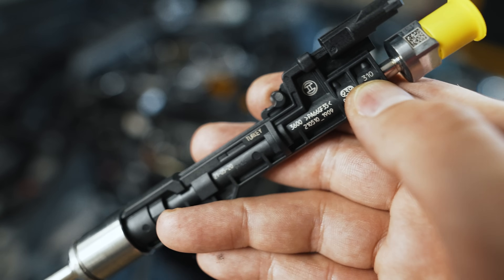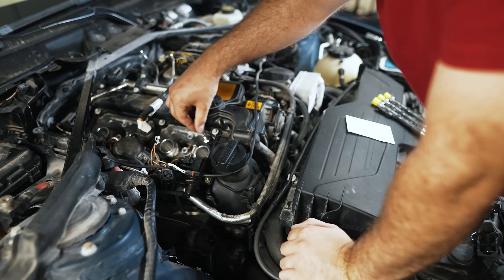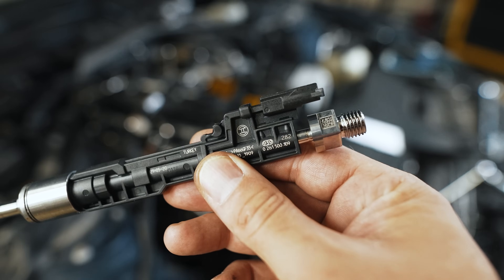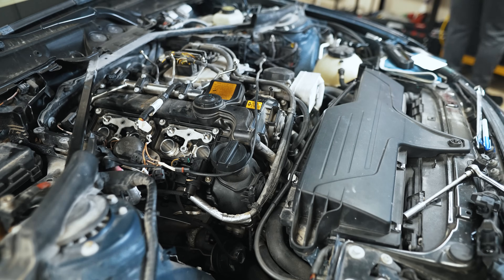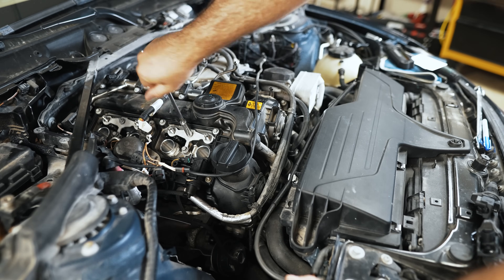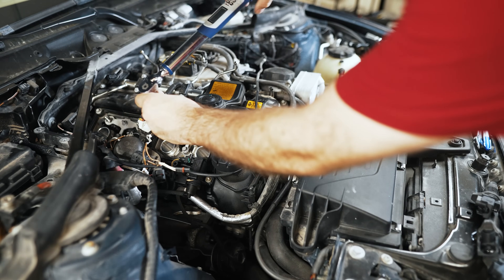To get these secured back in the head, you're just going to use the hold-down brackets. Cylinder 2 is 230. Make sure the green dot is down when reinstalling these brackets. Torquing these to 10 Nm.